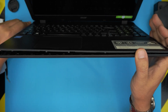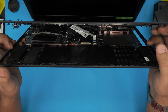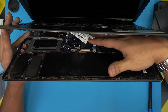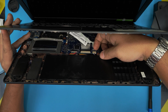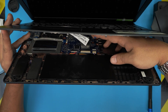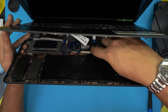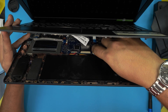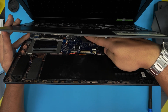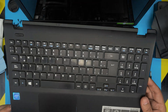This is fairly easy once you've done that. Now you can separate the palm rest and the bottom case, but don't yank on it — there are two flex cables in here. Pull the jack at the back of the trackpad upward and slide back the flex cable. For the keyboard, push the little lock towards the back of the laptop about one millimeter on each side, then slide back the flex cable.